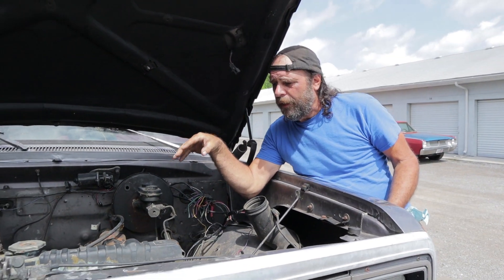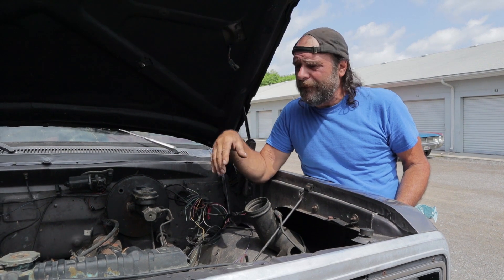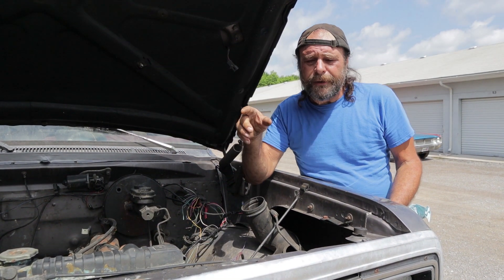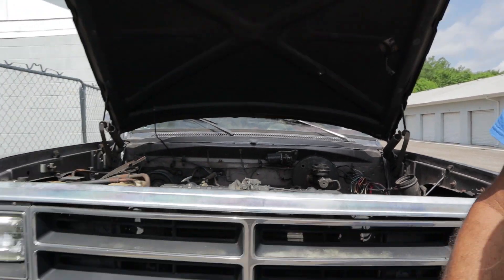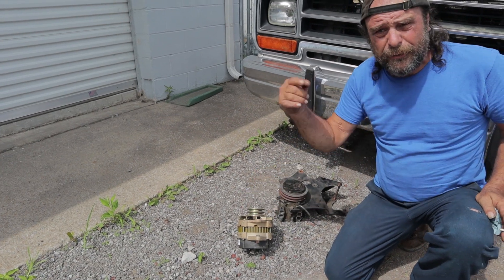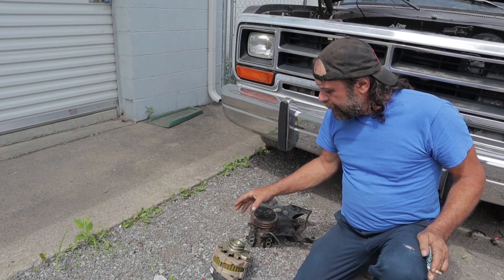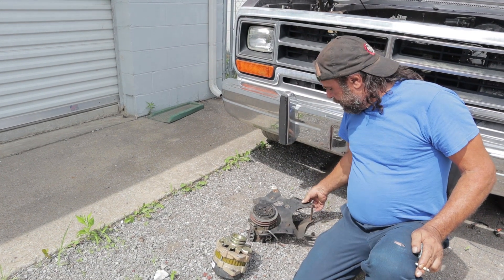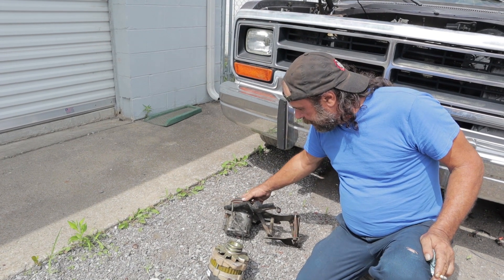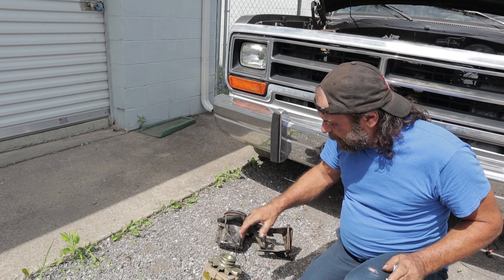Like I said, we're going to bring this car in line with the rest of our fleet, which is like early to mid-70s. So it's going to get the old-style alternator. Here's the bracketry, and here's the type of alternator that was used on this — it was regulated through the computer. What we're going to do is use the earlier-style Chrysler alternator with the external regulator and modify this bracket to fit it. We're going to keep the rotary-style AC compressor and get all of that hooked up.